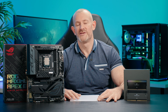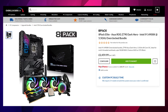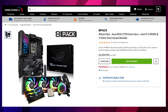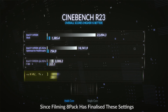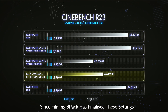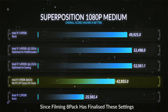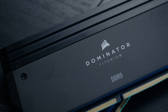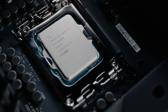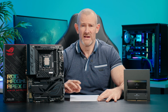So where can you get your 14900K tuned like 8-Pack? Here at Overclockers, of course. We'll be making hardware bundles tuned for both single-threaded gaming and multi-threaded and placing them on our website. Keep checking the bundle section. There might be a slight delay as we're still nailing down the single-core performance within the optimal number of efficiency cores, and whether to include a switcher-type overclock on the uncore as well. The multi-core bundle will be out almost instantaneously. The bundles will offer different memory capacities — all high-frequency — and different motherboards from the range I've tested, along with a range of very good cooling. The minimum cooling will be a 360mm cooler with three high static pressure fans.